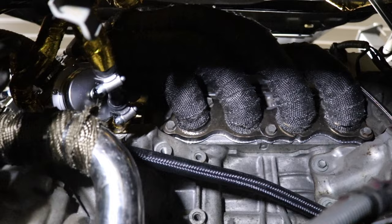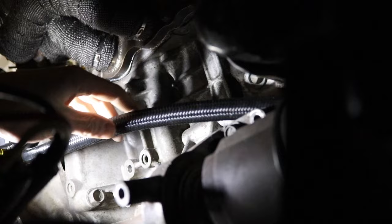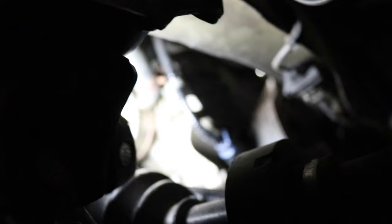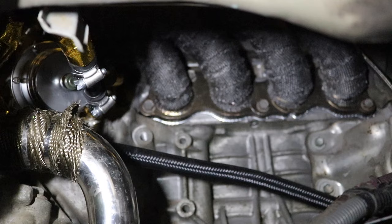Under the car you can see the AN line coming out right there under the wastegate, going across past the manifold. It does have a downward slope most of the way, so I think we're going to be okay. I think when we bolt the axle cover down we can put a P-clip on that mount to secure this oil line so it doesn't come back and hit the axle. Since we have the line run I'm going to work on securing it first, mark where we need to cut it with a white paint pen, and then install the chain tensioner cover piece Jack Spania sent us.